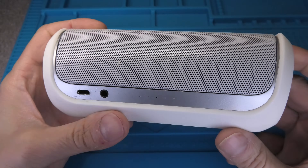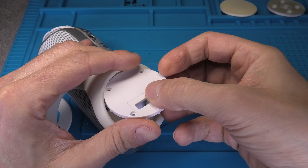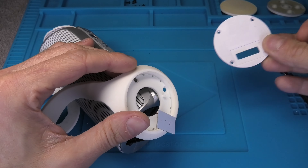Now we can separate the disc with the switches from the rubber piece — we slide the disc through the rubber piece and detach the entire rubber piece. It's kind of glued on so it is a little bit sticky, but eventually you will be able to re-attach it. We carefully remove it all the way down to the opposite side of the speaker, then detach it completely and take off the entire white rubber piece. Be really careful at this end because there is a cable going to that antenna — it is still connected. We detach the disc and separate the antenna with the prying tool from the other white disc. It is only glued into position, and then we slide the antenna through that little gap and push it through the small hole in the rubber piece.